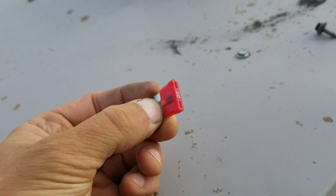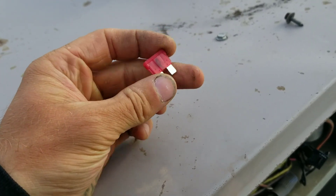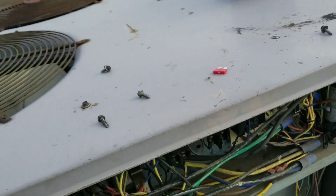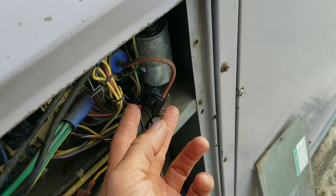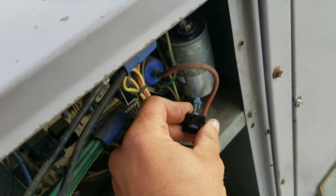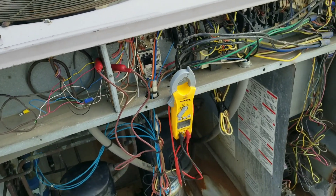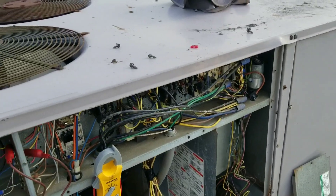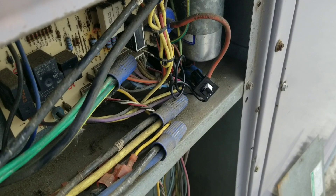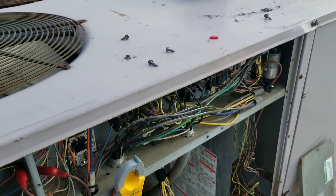It's supposed to be a 5-amp fuse. There's probably no real big deal, but when I replace it I'm going to put the proper size fuse in. I have my little 5-amp popper hooked right up to the board just for testing purposes. I'm going to power it back on — we should immediately go into cool mode, or our popper will pop if we still have a short. And it looks like we still have a short somewhere.